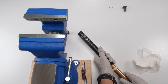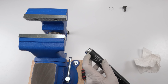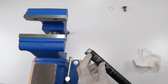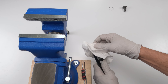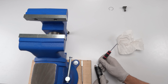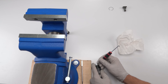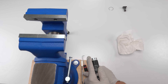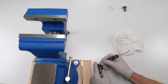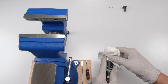Before we take this out completely, let's look at the bottom — there's the bearing. This bearing is spot-specific. There's a bunch of dimples in the bottom collar and we want to mark where that bearing is. The best way to mark it is just give it a little scratch underneath. If you use marker, you might clean this with alcohol and the marker will be gone — so just give it a little surface scratch. The scratch won't do damage and it'll still be there after cleaning.